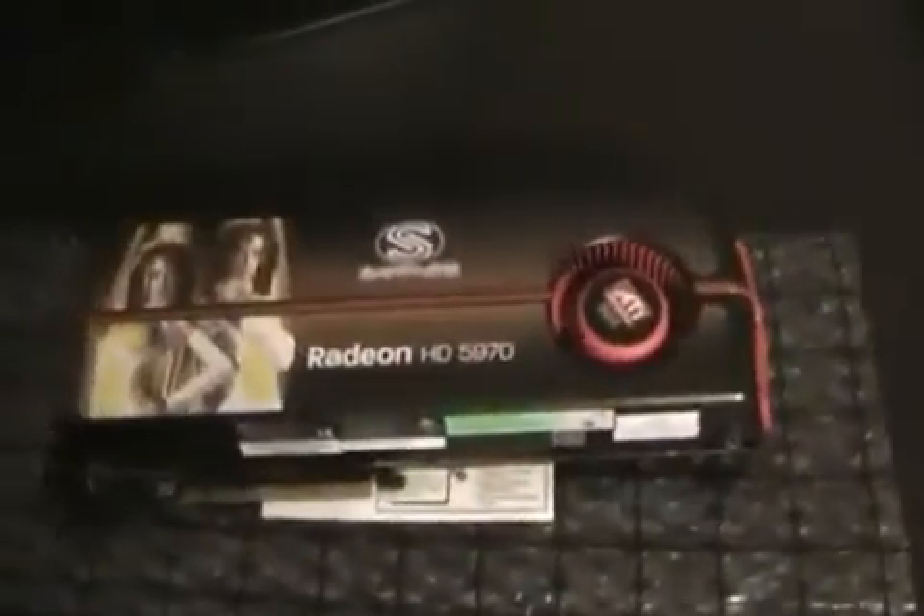Alright, so now I'm going to be putting it into my case, which is right here — the other card's gone. This is a fairly large case too — it's a mid-tower. Look how big this thing is in here. I can barely clear it. That's where it stops; this is where the intake fan is. It's such a tight fit. I have literally just over an inch clearance. This is a very large card, so if you're looking at buying one of these, make sure your case will fit it. I don't want someone going home having just spent $700. That's right — $756 to be exact for this video card. Double check — make sure your case will fit this extremely long card, almost 14 inches, because the other one was 12. Keep an eye on my channel. Benchmarks, baby. It's going to be a long night tonight.